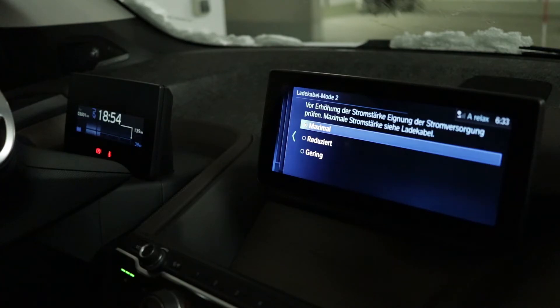Please take into account that I'm doing this on a car which is very active — the display is on and so on — and this also reduces the current available for the battery. If you charge a car and it's completely closed, the charging time will additionally be reduced because all the electrical things in the car are off and it just concentrates on charging.